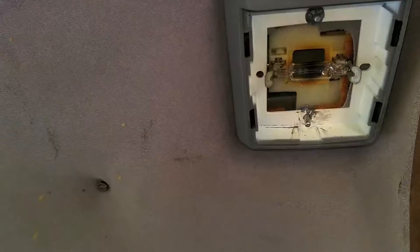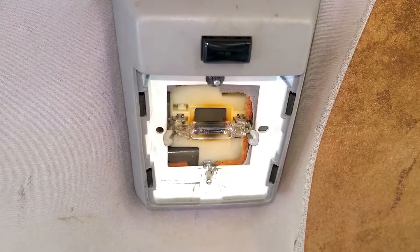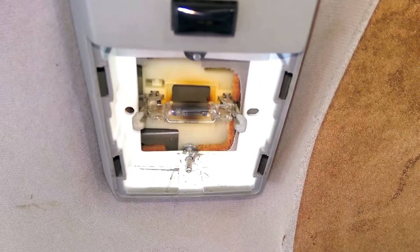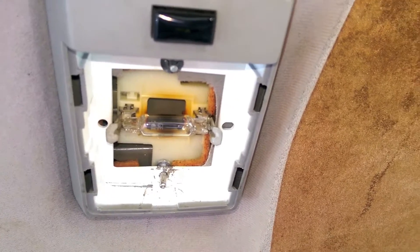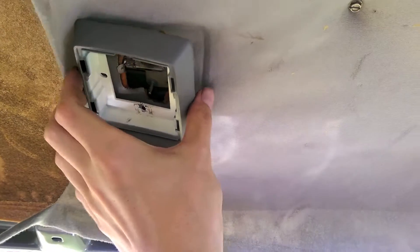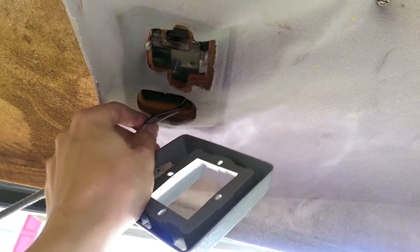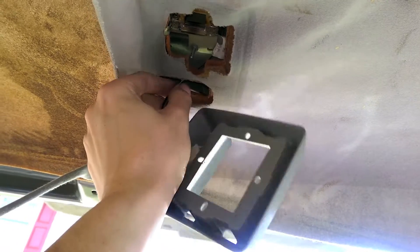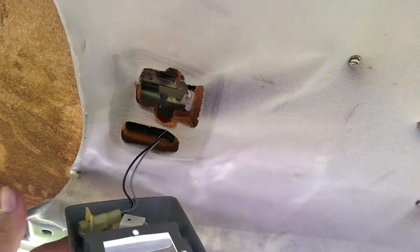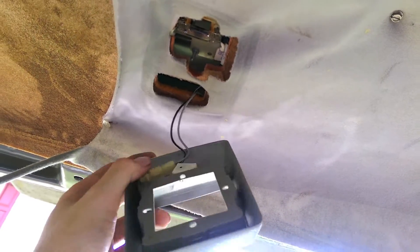Since you're working right next to the dome lights, disconnect the battery or pull the fuse, because if you jump these contacts you're going to short out your dome light fuse. Battery is disconnected right now. Once you take both sides out, this just comes hanging down. You're going to want to disconnect this — there's a connector farther back, or you can just disconnect here and you'll be fine. Pop that out and you're free in the back.